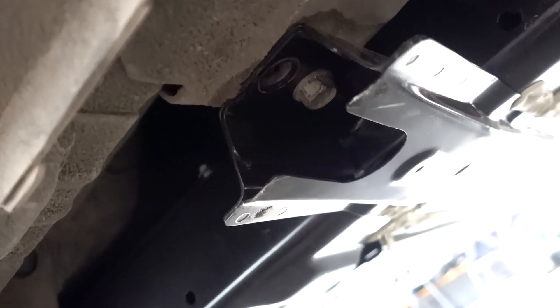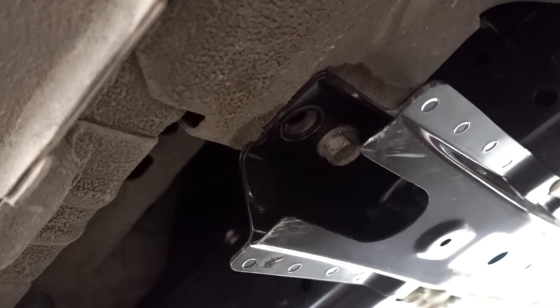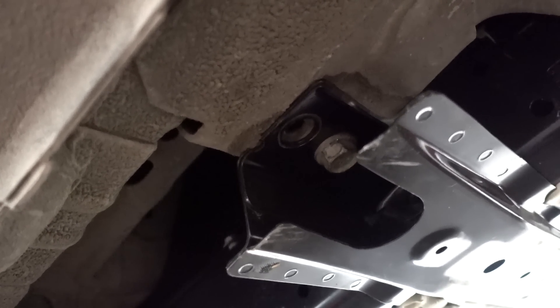The battery is in. This is the rear of the battery with the new extended supports. This bolt fit in the original mount. The 62 pack originally uses two bolts, so I'm actually gonna sneak in another bolt here — it's open here, so it's quite easy to get a nut in. That way I can get another bolt to fasten here.